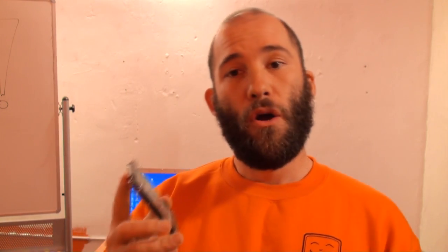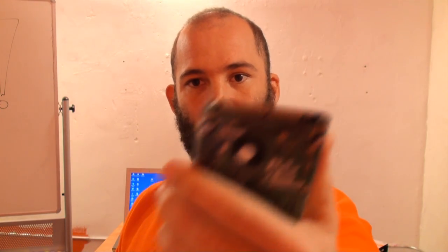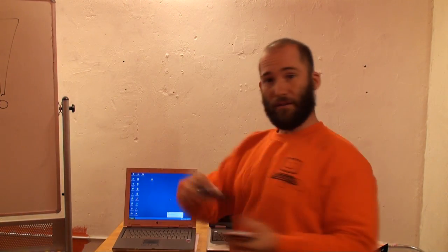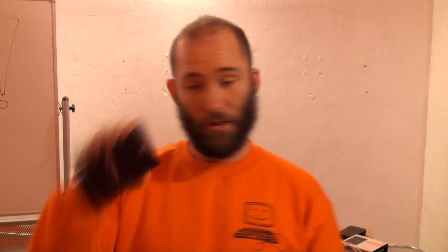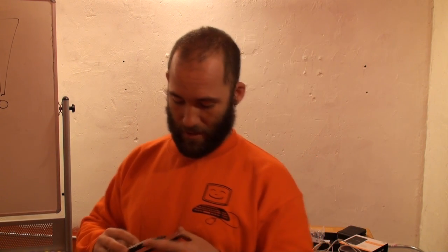We pull the laptop hard drive out of the computer. This is an IDE laptop hard drive. One thing that confuses people is if they look at the connector of a laptop IDE hard drive, it does not look like an IDE connector at all. The reason is they always put a little adapter on the end of the IDE hard drive so that it can connect to the computer. So if you see a connection at the bottom of your IDE laptop hard drive that doesn't look like an IDE or SATA connection, that is an adapter — you pull that off and now you have the normal pins of an IDE hard drive. Now we get our IDE laptop hard drive enclosure and plug the hard drive into it.